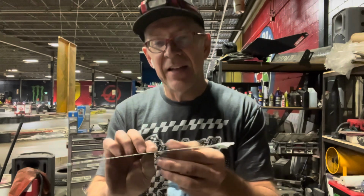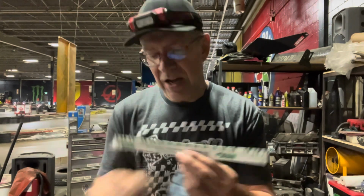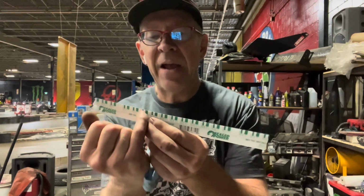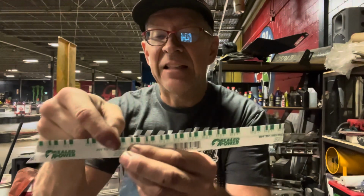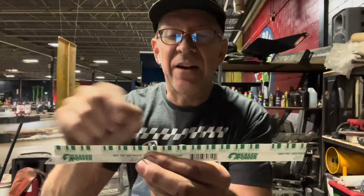It squishes it, and then once you've got it squished on each of them, you can compare how much it's squished to this little chart, and if it lands up being squished the right range of what you're looking for, then you know you have it the exact right gap that you need there.